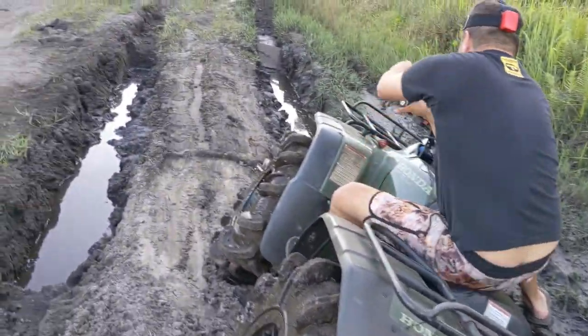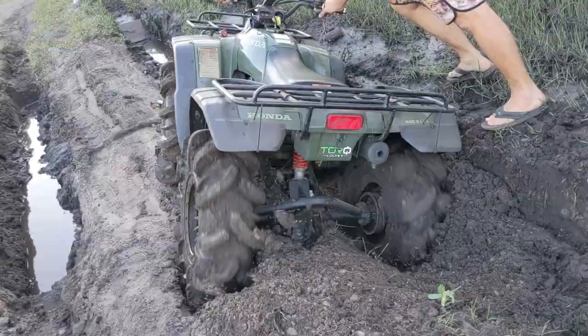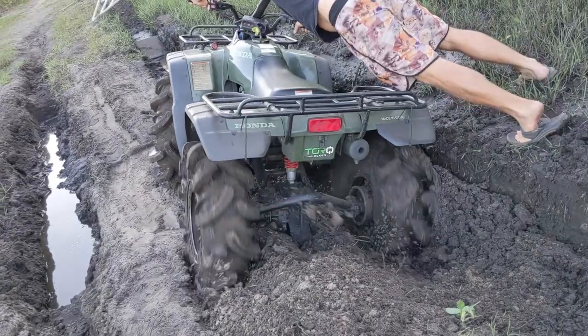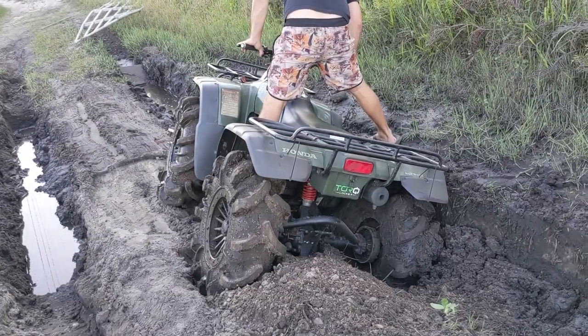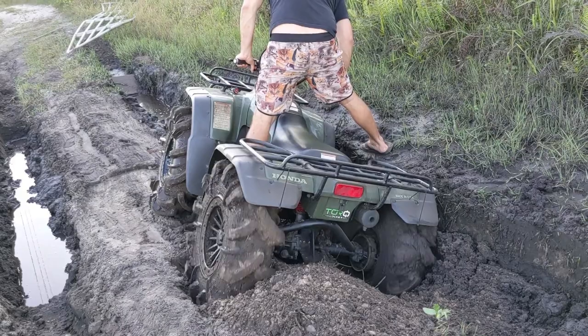Broken. Yeah, this thing does not feel right. Noticed at the house a little bit, but it didn't feel like it. So what's actually going on here is it's running out of gas because it's leaned over to the right and the petcock is on the left side of the tank and I forgot to fill it up. Once I put it on reserve, it cleared right up.